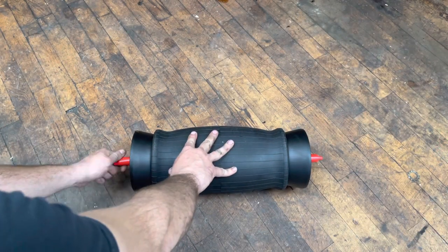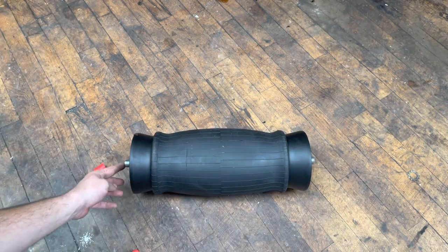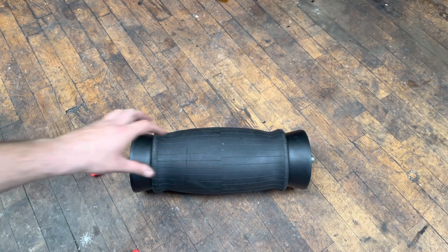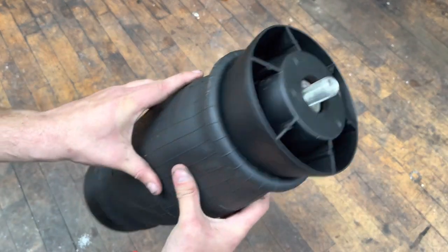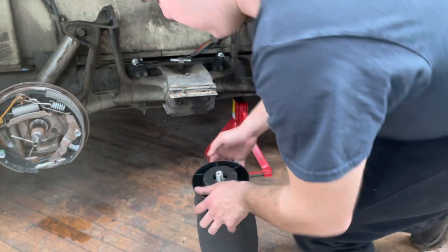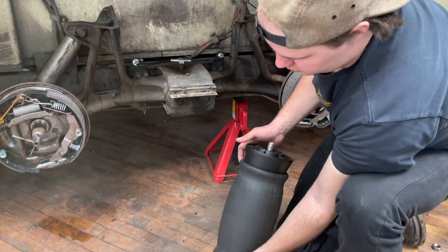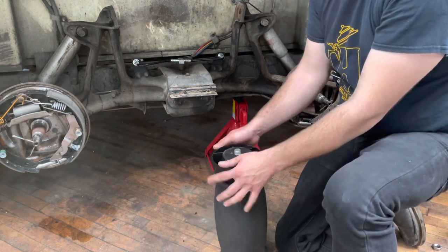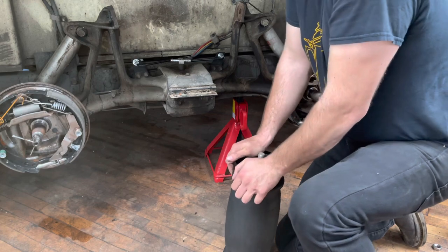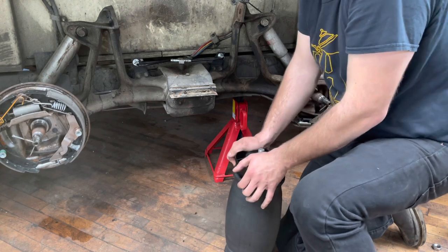When you remove the little red protection pieces from the airbag, it will be obvious which side goes where. One end is open and one end is closed. Here's the open end and the closed end. When you're ready to install your airbag, put on your end caps and press firmly down on the ground because you need them to be fully seated. You'll notice there's not much thread sticking up, but when you put on the new hardware it will draw it through — it's better to just prep it like this.